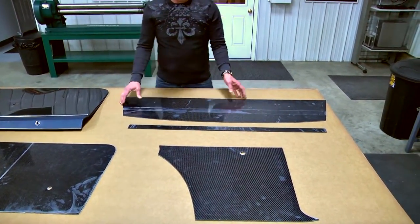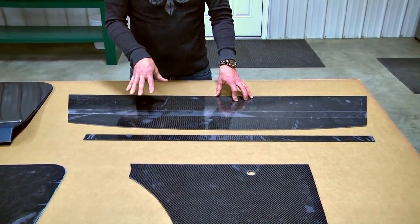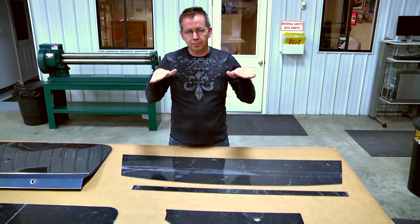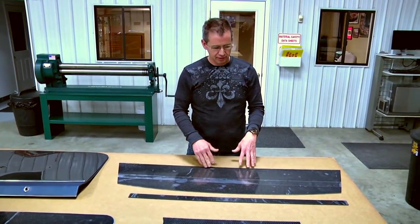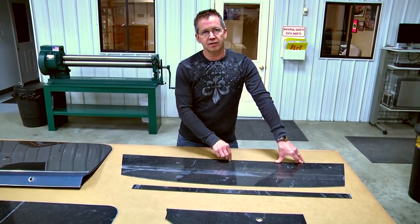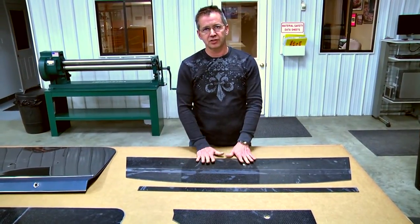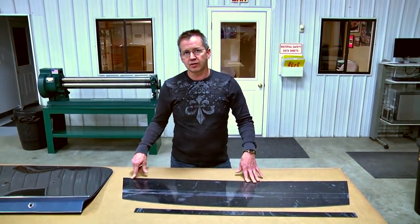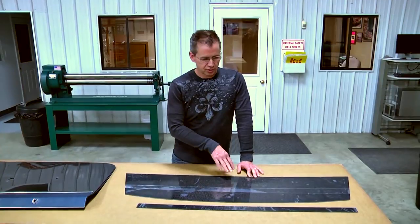The package tray is really simple. There are a couple of different options — you can remove the stock package tray or put this right over the top of it. It will slip under. There are a couple of little corner moldings attached with Phillips screws; take those out and this will bow up and slip in. To hold the front part down, which goes right against the back of the back seat, you can bond it with silicone sealer or any 3M sealer. Just tape it into place and it'll stay flat. If you remove the package tray, you can use the extra black screws we send along — put about three of them across the front.